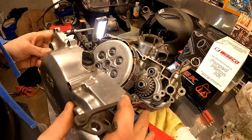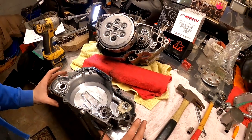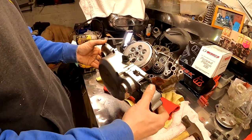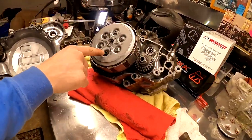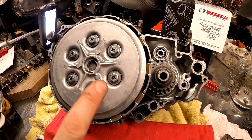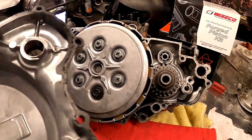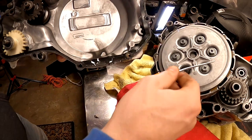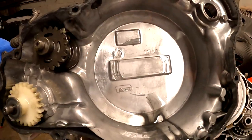All right. First thing you want to check for, make sure nothing dropped out on you. Flip your thing over, take a look, make sure nothing seems out of place or a washer that's going to come loose. So our clutch cover's off, and one thing I noticed right away, you can see a standard bolt and a blackie aftermarket. So somebody definitely replaced this bolt in our clutch, and you could tell on our case, even by the distance here right away, that this bolt must have worked its way out at some point, and that was rotating and hitting this case there.